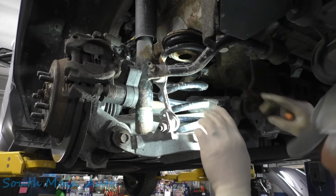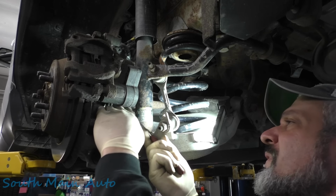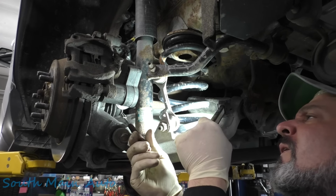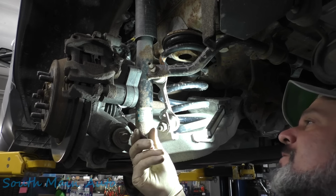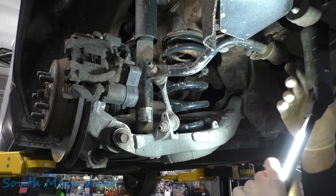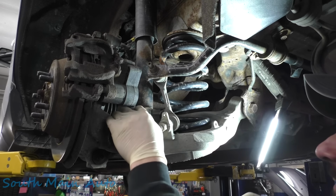See that side's plugged in. Also brought a mirror. I wanted to look back up in these terminals, see what the inside of this motor looks like, if we can see in there. Make sure it's just not missing a terminal. Yeah, it does have one that's crusty. One is shiny, one is crusty. I don't know if it's migrated back up into the motor or not, or maybe it's not the issue, but it's an issue. That's for sure.